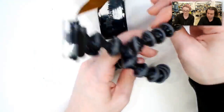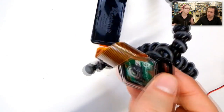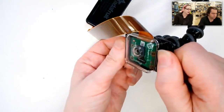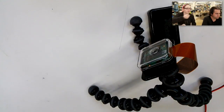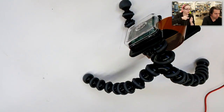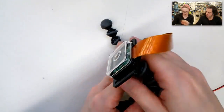A lot of camera devices have a tripod mount, and you'll find all sorts of things — not GoPro, but almost anything else — will have a little mount you can attach the camera to. There are also little slots for Velcro-y things if you want to attach it to a generic thing that doesn't have a screw attachment. Or you can grab a quarter-20 screw from the hardware store and screw it into the back — just don't screw it so far that it pops the camera out or pushes it through the case. Just go until you feel the camera hit and back off a little bit. We've tested it with a bunch of small tripods and they all work really well. Two nice cases.